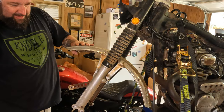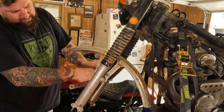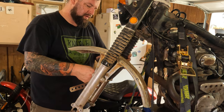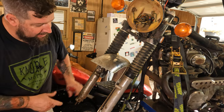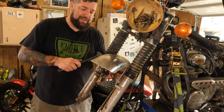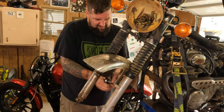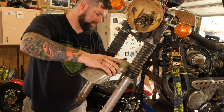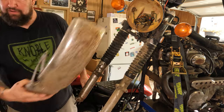Now inside here there's a bunch of bolts. Take a 10 millimeter socket and just lefty loosey those on out of there. Down in here there's another locking washer bracket — bend the metal tabs back. From there, you should be able to wiggle your front fender right on out of there. Set it off to the side where you're not gonna trip over it.